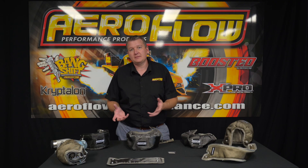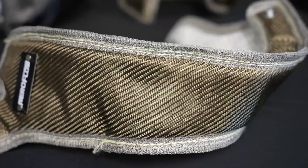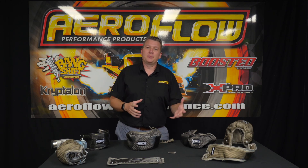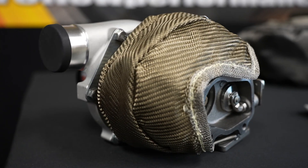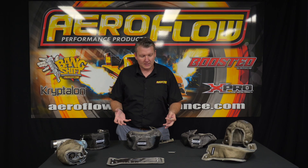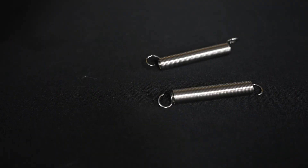We also have direct fit applications — whether we're talking a small Nissan internally gated turbocharger, Mitsubishi Evo (which is this one over here), WRX, or the R35 GTR. They'll all bolt onto the factory or factory replacement turbochargers and strap around. When you fit it over the turbo, you want it to be nice and tight and snug on the turbine housing. If it's too large it won't keep the heat in; too small and it won't cover the area and will be very difficult to fit. Once you choose the appropriate size, you use the supplied springs that latch onto the lugs on either side of the bag to hold it down tight.